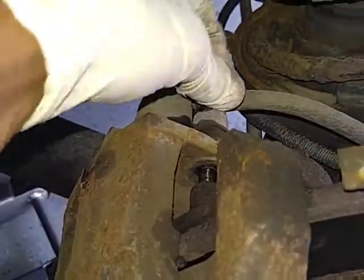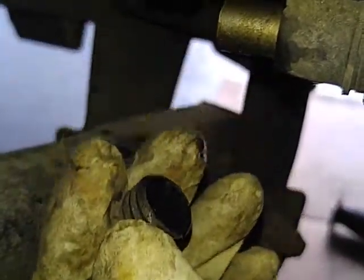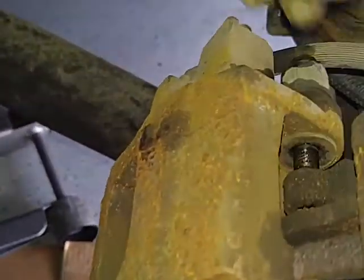So there's a little bit of rust. Back here, these two plugs will be installed on there. Once you get those off, behind them it's two T-45s. I'm going to go ahead and loosen those up, and sometimes you might need a screwdriver just to push back on it.